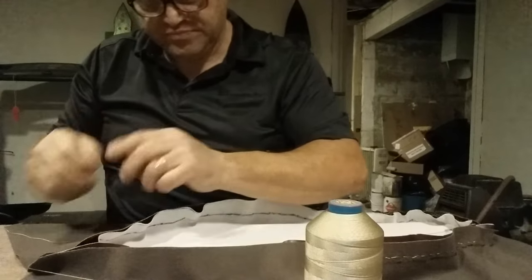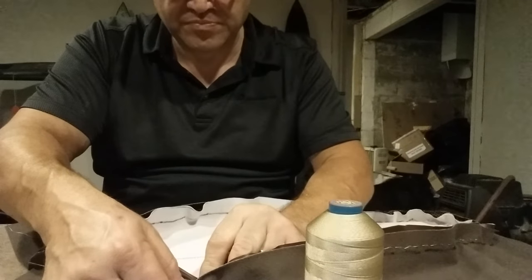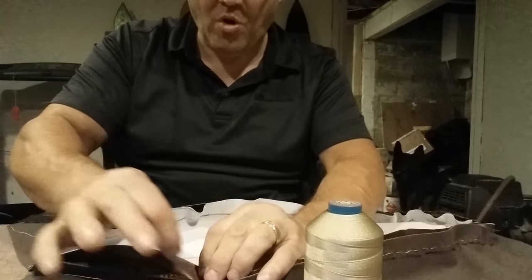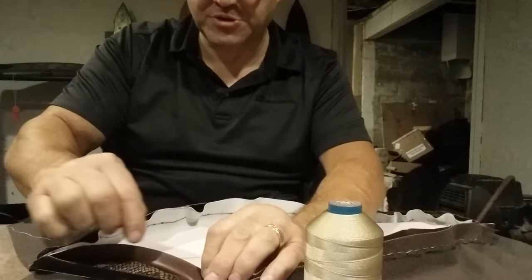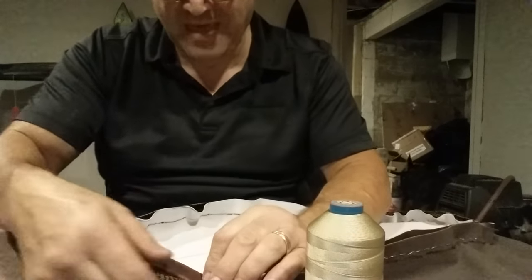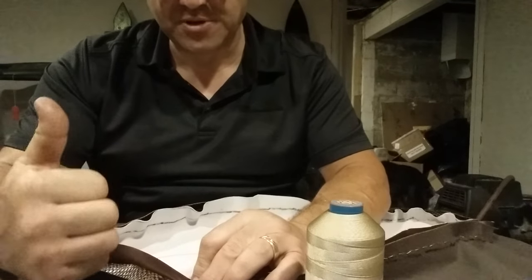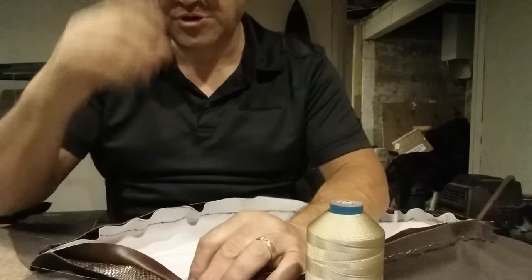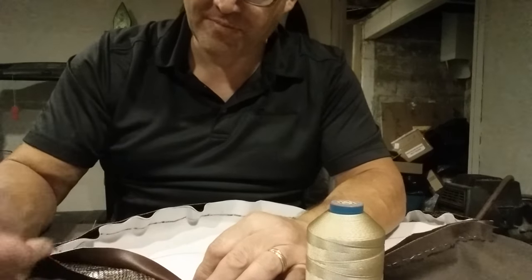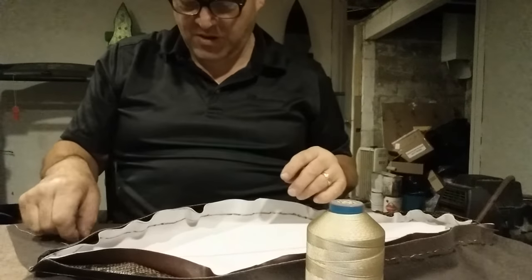What we'll do is split this open. I'll heat this up a little bit so once it cools it'll lay flat. Then we're going to get a piece of this chestnut material about that wide, and with the hemming tape we'll put it all in here. That way when you look at this seam from the finished side you'll actually be able to see inside the seat, and you don't want to see the yellow foam — so what you'll be seeing is the chestnut material. That's why we have to put a piece in there. I'll make a video on it when I do that.